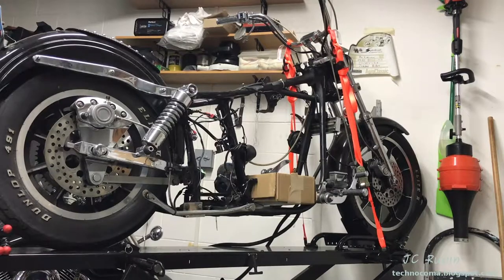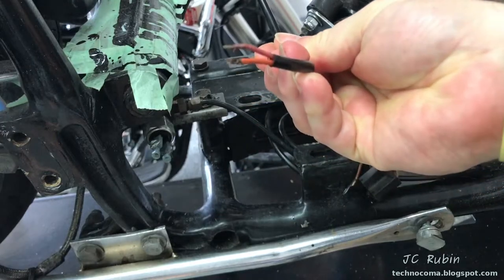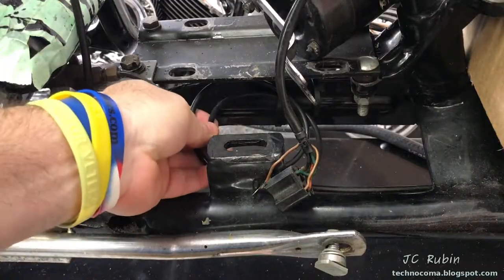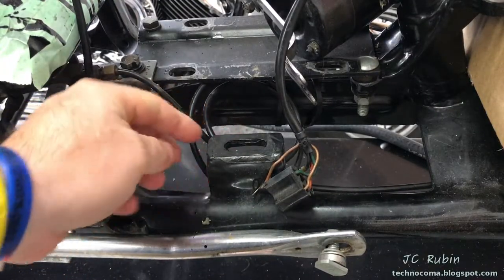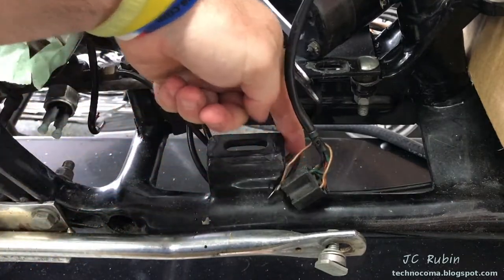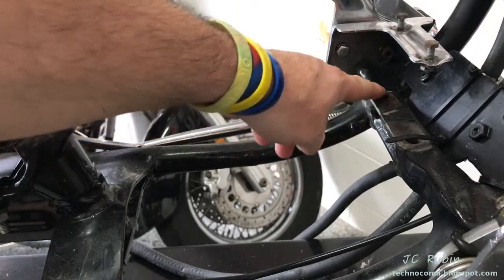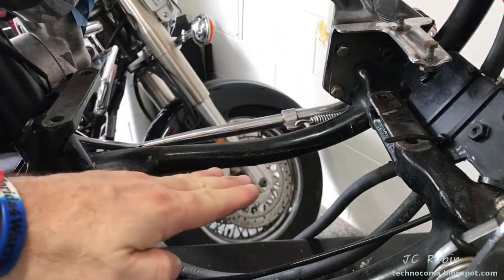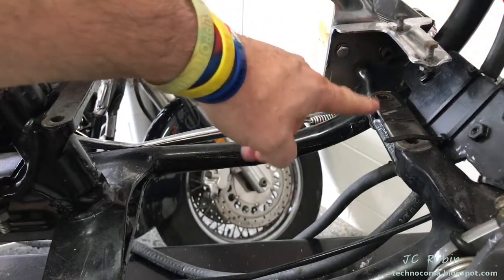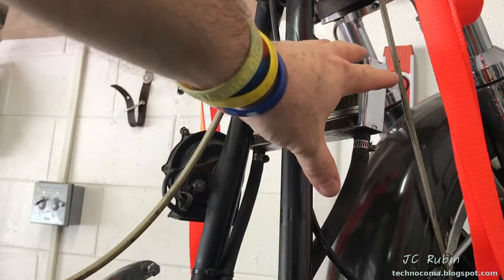Going right down the list: some cables are broken - I'm going to repair those connectors by soldering them, I don't like crimp connections. There's an abundance of brake line going to the rear brakes with a big loop wrapping around before it goes to the fitting - I want to remove all that. The engine mounts aren't flat, particularly around the holes from damage caused by the loose engine, so I'm going to deck these and make them nice and flat. The oil cooler, associated hoses, and thermostat all need to be removed and cleaned.